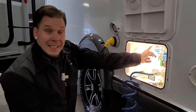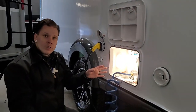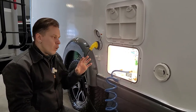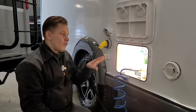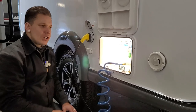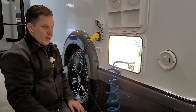We also have cable and satellite inlets. If you want to feed either a cable service or an aftermarket satellite package to the unit, you'd use those. Some higher-end campgrounds provide that service, and just about every satellite provider offers a package geared towards RVers. Those inlets terminate at the designated TV area of the camper — just a pass-through connection to feed those services into the unit. Right beside that compartment, we have your Alde vent. Not much you need to do as a consumer, but keep it free breathing — don't put anything in front of it. It does blow very hot air when the Alde is on, so make sure you let it exhaust.